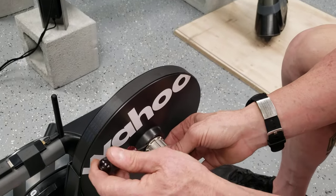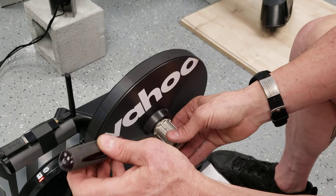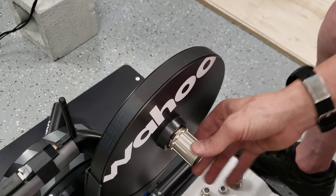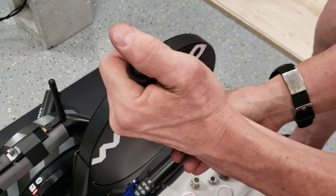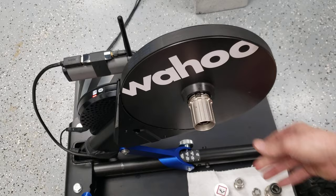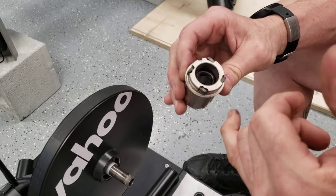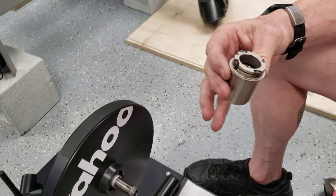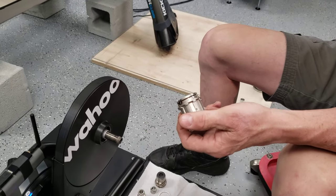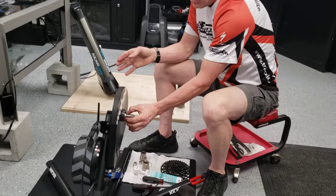Apply gentle pressure and turn it in quarter-turn increments. Once you start to see teeth appear, make sure you're not prying around the teeth. Use bigger screwdrivers and twist them for better leverage, then try pulling on it. What happens is the inner bearing rusts and gets corrosion on it — I don't know if it's humidity at the factory, but even in a climate-controlled environment these bearings corrode.